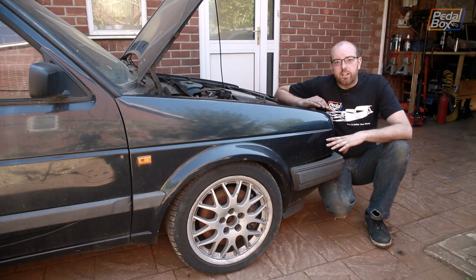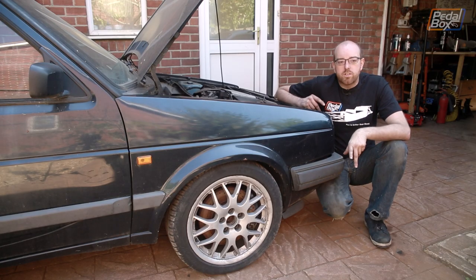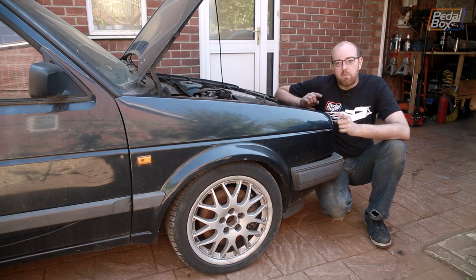The struts in here aren't the original ones that came with the car either. I put these ones in about a year or so later — they're just some stiffer springs, but otherwise they're normal struts. So I'm going to pull these out and put the coilovers in that we got for the project. Our kit car only needed the rears, and I specifically bought Mk2 and Mk3 rears because they were simple enough to fit and convert to fit on that, but also because it came as a set of four, it meant I got some new front coilovers to put on this.